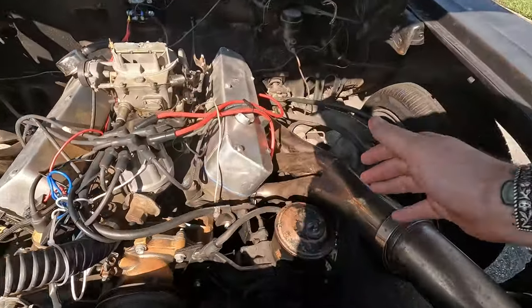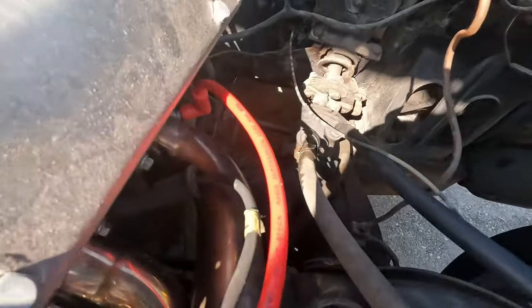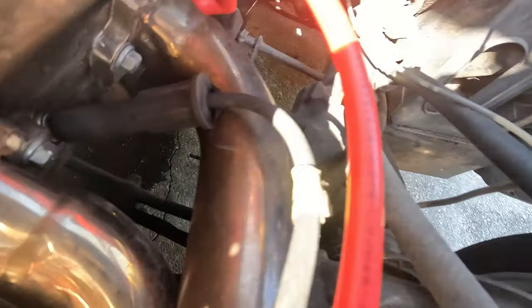Namely, they left the straight boot spark plug wires attached. You can see on that one really well that it's just kind of melted to the header, which is not really conducive for a good strong spark — and that's kind of what we need to run well.